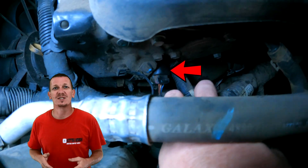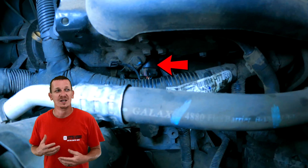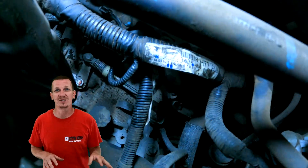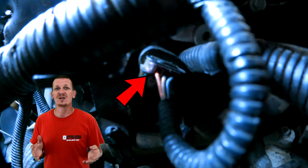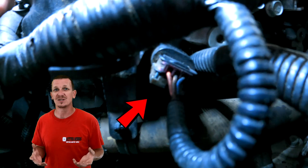So let's go ahead and replace the intake VVT solenoid on this thing — and that ended up being the actual fix. She's been driving on this for four days and has not had the drivability issues she was having prior to me replacing these components. I truly think it probably would have been fixed with just that VVT solenoid, but we got both the sensor and the solenoid, so we know we're going to be good for a super long time.